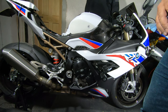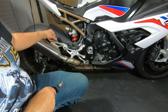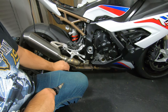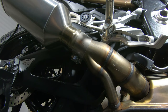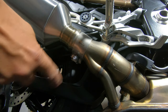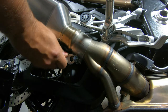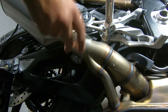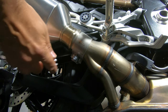We've just got to do the other side and then we can crack on with the other bits. The next problem is that one of the bolts is actually right behind the exhaust. So we're going to have to remove the exhaust, take the end can off just to get to the bolt which is down here. You need a number 13 spanner — put it on the bolt here, it will loosen off nicely. And you can undo the exhaust clamp. Once you've removed both bolts, you'll be able to remove the exhaust end can off and we can get to the bolt.